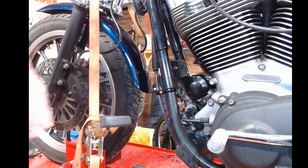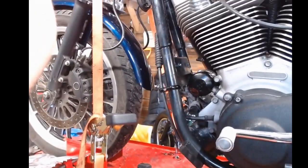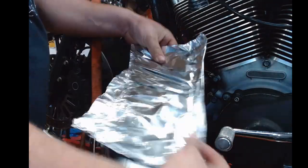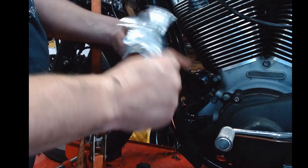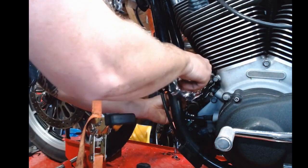A lot of people struggle when you take the oil filter out — you get oil all over the area down here and it's hard to clean out. One of the guys from my 101 class once suggested using some aluminum foil and making a little drain pan out of it. Proof that you never stop learning. I don't remember the guy's name, but whoever he was, thank you very much — it's a tip I still use.